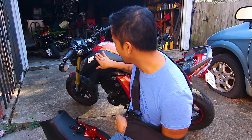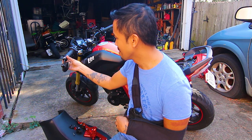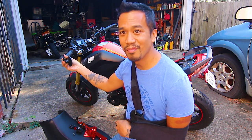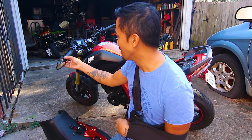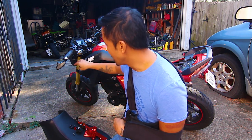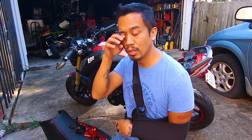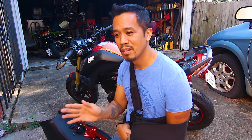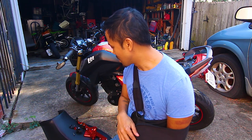If you also look, there's a little bit of scratches right here, and then the mirror is — for all intents and purposes — useless now. All this stuff got bent and ground down. And then if you look on the front, the headlight, which is plastic, it got scratched real deep and I went ahead and did a 150 grit all the way down to 2000 grit and then polished it smoothly. I haven't got to the last polishing step yet, but I should be there soon.